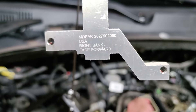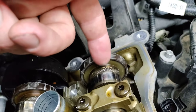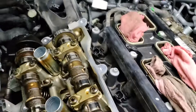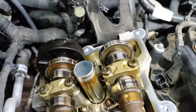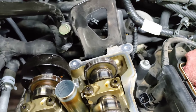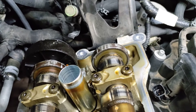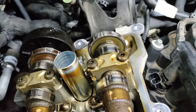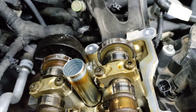So this tool will tell you — you don't have to guess — if this tone wheel right here has moved. If this wheel has shifted independently of this camshaft, then your timing is going to be off and you're going to have a P0340 code, as well as other codes related to camshaft correlations between the two camshafts. I have looked high and low across internet communities, forums, through YouTube, and only found one technician — his name is JT — that talks about it, but he has yet to post a video on how to use the tool.